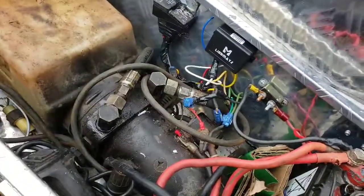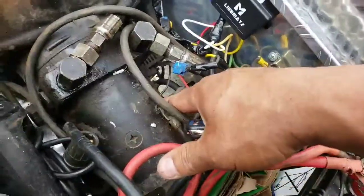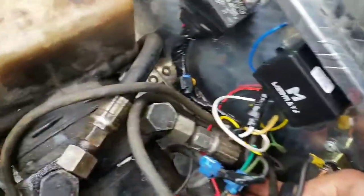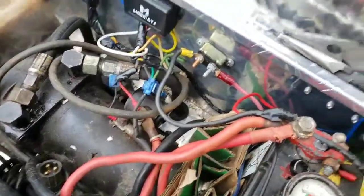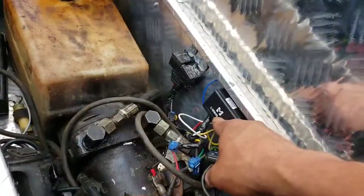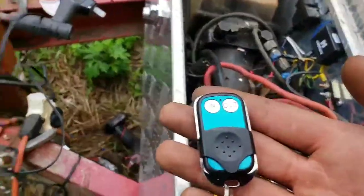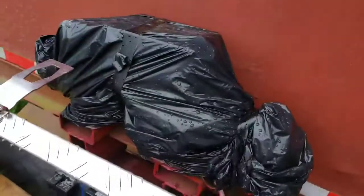There's a valve in there and this is the solenoid that triggers it — positive, negative. But this solenoid is only one activation. So there was no other way without worrying about overheating this. If you get two relays, you can use the winch remotes for the dump trailer. They don't tell you that in the listing.